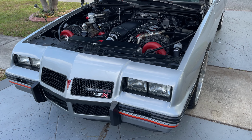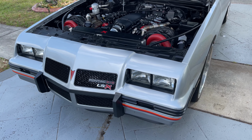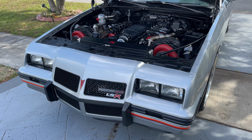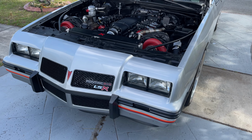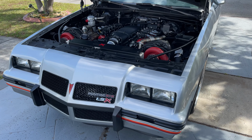As for the fuel system, I got a MagnaFuel external 750 pump with a pre and post filter. I'll be showing you guys in a little bit, in the back. As for the injectors, I got 1200 cc FIC injectors. Fuel system, she's on point. Like I said, car runs amazing.